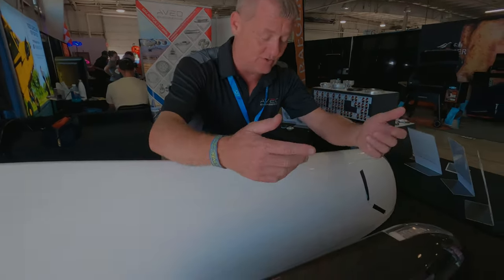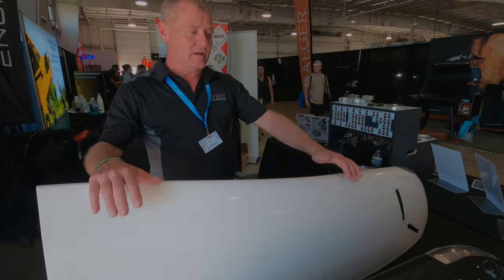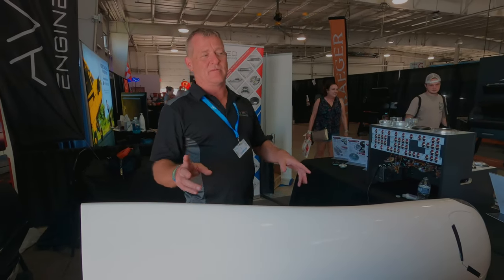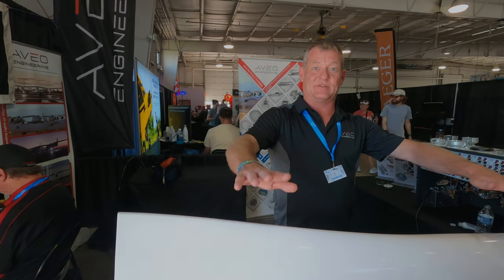For the Cessna, it's $200 more, but let me tell you, if you're gonna do carbon, be my guest, but I would recommend, we offer a 3/4 carbon, which means you tell me what wingtip you're gonna put your antennas in, and I'll build you a full carbon on the left, and if you're gonna put it in the right, we're gonna build you a top carbon, bottom fiberglass, a 3/4 set. Okay. And then you can put your antennas in and they'll see things, whereas if you make it all carbon, they won't. Right on. Don't ask me how I know that. Lessons hard learned in the industry, but absolutely. Everybody's going to figure it out.